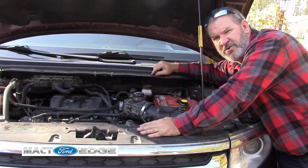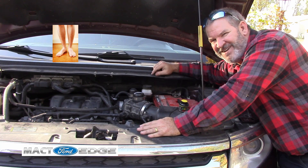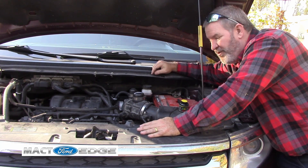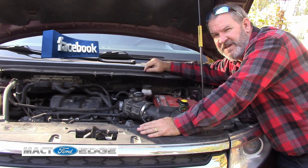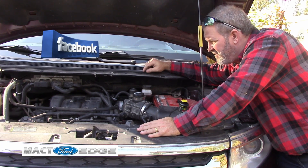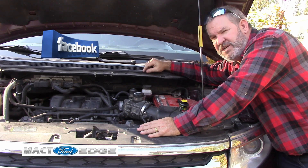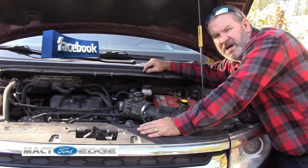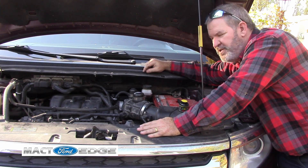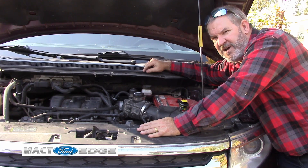We got this repaired. All the traction control and the emergency braking system seem to be popping up because of the purge valve. Keep in mind that the PCM does detect everything, and it sometimes translates it to drivability issues — if the fuel system ain't working, it goes to the powertrain, and if the powertrain can't function right, all sorts of wacky things will happen. Go over to that Facebook page, join up and meet me and the administrators in there. Subscribe to the YouTube channel — hit the subscribe button and see these videos when I put them out.